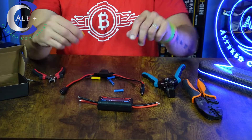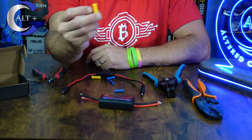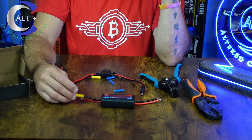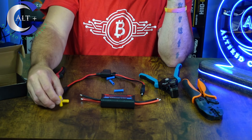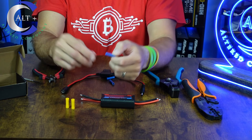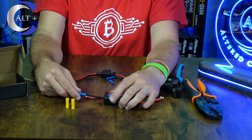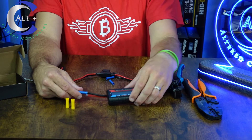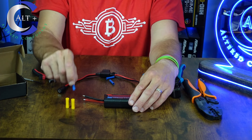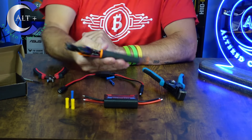So we got some supplies. However, this is 12-gauge wire, and if you're using connectors you should use the yellow ones so it actually fits properly and you can crimp it right. I could only find two yellows, so we're going to do the positive wires with the yellow 12-gauge, and then jam the black into the blue 14-gauge connector. Don't do what Donnie Don't does — that's not the proper way, and I'm just doing it as temporary until I get the yellow connectors.